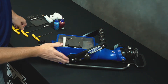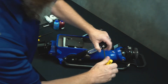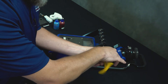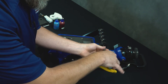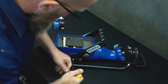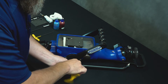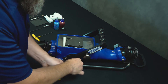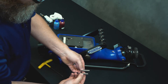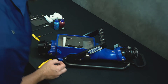Next, we'll take off the right side handle. Using the 7/32nd Allen wrench, go ahead and remove the upper and lower screws that hold the handle on. The upper screw gets reused. The lower one — we send a replacement in the kit, so you can set it aside or discard it. This is retained with red Loctite on the lower screw, so that'll have a little bit of resistance initially. Note that these are two different length screws: the upper screw is shorter than the lower.